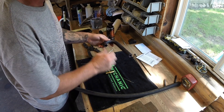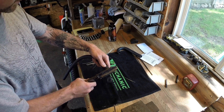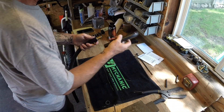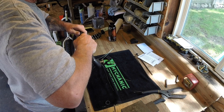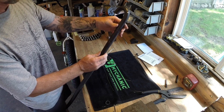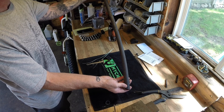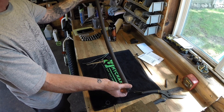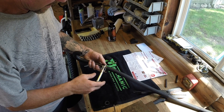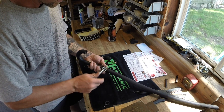My blade's getting dull so I need to change it. Then I'll make sure this end is good and square. I'll take my Clamptite tool and put a clamp-tight band around both of those. There is my crankcase breather hose that I basically just threw together from some pieces and parts from O'Reilly and Lowe's. The barb came from Lowe's — that's just a five-eighths double barb. After you get that wrapped around, it goes over the pins up front, underneath and on top, then you twist and start tightening everything up.